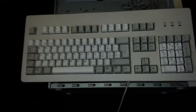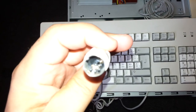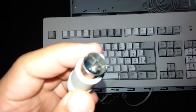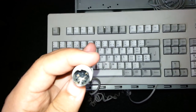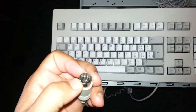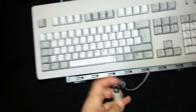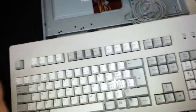Let's talk about the keyboard. We do have a keyboard right here designed for Windows. This uses an AT connector, which is very different from PS/2 because the connector is bigger and has a different type of connection. It has five pins inside and there is a notch that is supposed to go directly into the motherboard.